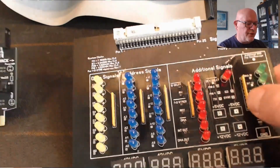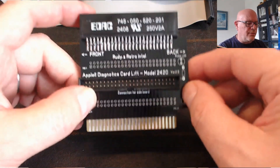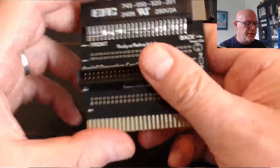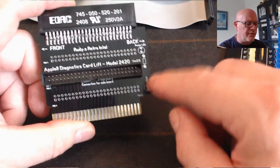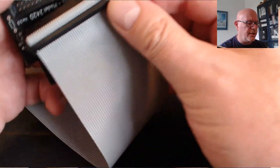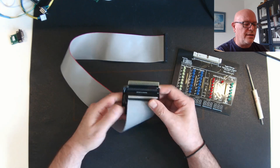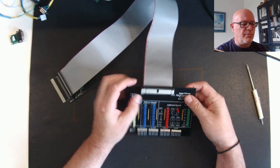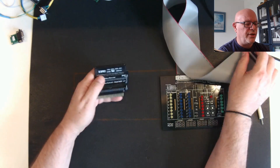Now how does this plug in? You have to plug in this small card — I call it the lift card — which plugs right into the slot of your computer. It has indication for the front and the back of the case. This is the newer version of the board, coming out soon. The ribbon cable plugs into the lift card and has a notch so it only goes in one way, ensuring pin one lines up correctly on both ends.